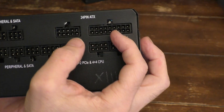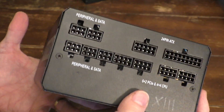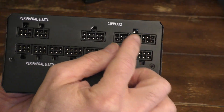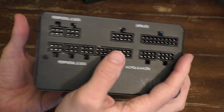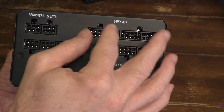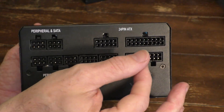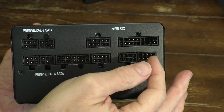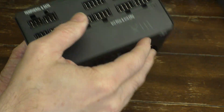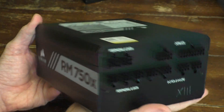So it's a little unclear where the power-on pin is in this particular power supply unit, and it gets more complicated. For different Corsair units, you could have different pin combinations, so they're not all identical. Some of these units actually have 24 pins on this side, some have 28, and some are pinned differently. So you have to be careful when testing, because you don't want to power it on and short two pins that are not power-on and ground. You could totally screw up your power supply and also create a big shock. So you want to be sure about what you're doing with these units.